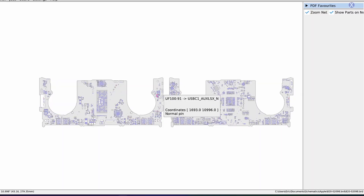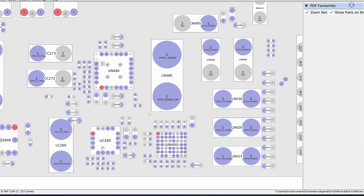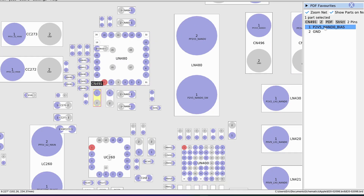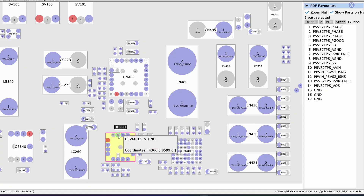So we have our board view — this is basically a map of the board itself. The area is over here. There are these two big chips: the UN-480 and the UC-260. The UN-480, if you look, you can see NAND in there — that usually means some type of power to the NAND itself. Everything around this area has something to do with the NAND, because when you have a main chip you usually have capacitors and resistors that are part of that circuit. We know that there was liquid damage around the CN491, which is part of the power circuit for the NAND. The other chip below that, which we may need to replace, is also just a power IC. Since we know what it is and where the area is, let's go ahead and fix it.